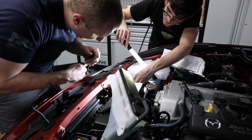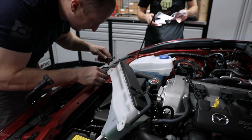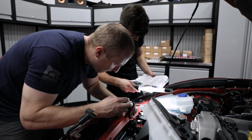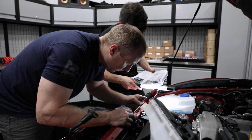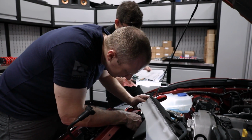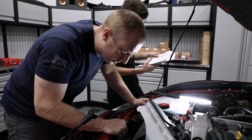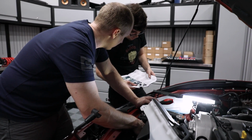Okay. But then what do we do with that? Yeah, these instructions. There are 2 ground points under the air box. Do not disconnect them. They are electric power steering, and if left disconnected, steering effort will be very high. Okay. So we're taking the fan out? What was the point of this? Apparently that shroud needs to come out then. Now we go on to 4.